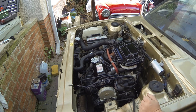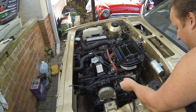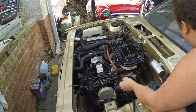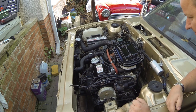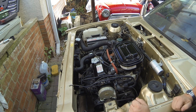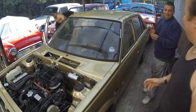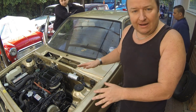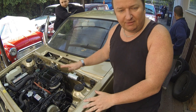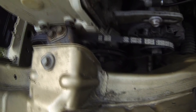Oh, that's as quiet as anything isn't it! How about that - that sounds absolutely lovely. It's the choke out, just push it another bit. I didn't think it was going to start for a minute. It was reading empty on the fuel gauge but that actually sounds superb. When I first heard it start up it was tick tick tick tick - there's none of that now, so bearing in mind we've done the valves. I'm just going to connect the timing light now and get the timing accurate. There's our timing marks down there.